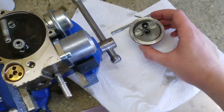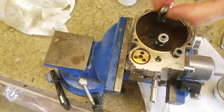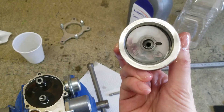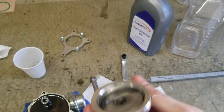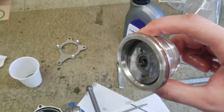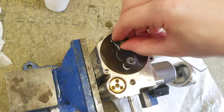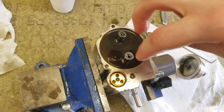Once you get that out, this one's got lots of oil in it already, but if there isn't lots of oil then there's your trouble. On the back here you've got an angled plate called a swash plate. When it gets turned by the cam, you can see the low side and the high side rotate, and that pushes down alternately on each of these pistons as it turns. So this one goes and then it rotates a bit more and the next one goes, pushing on each of these pistons.